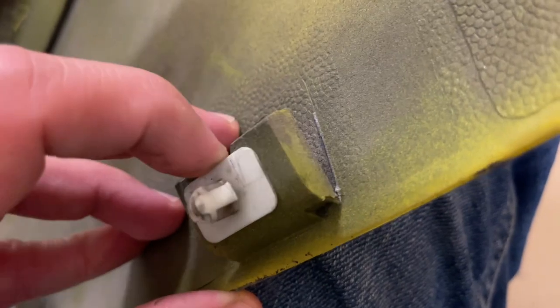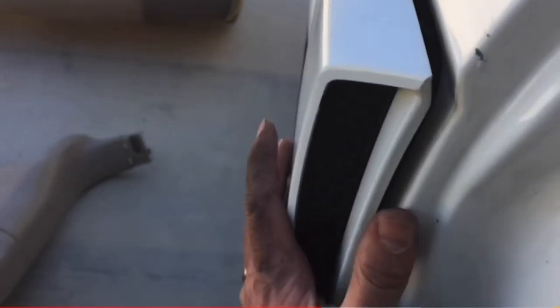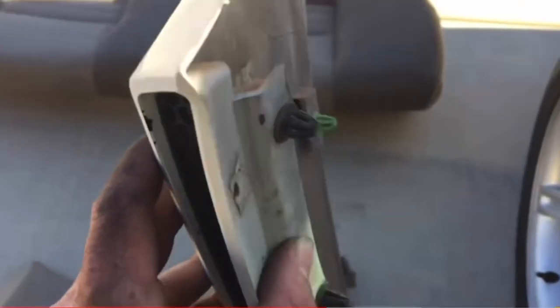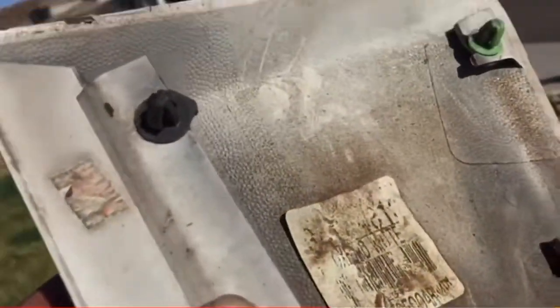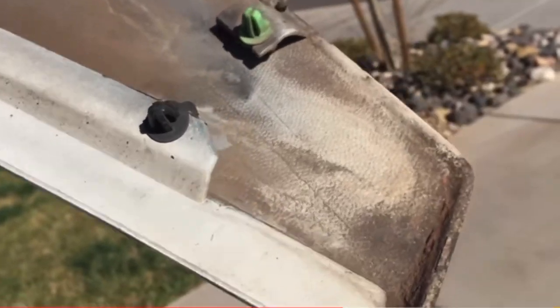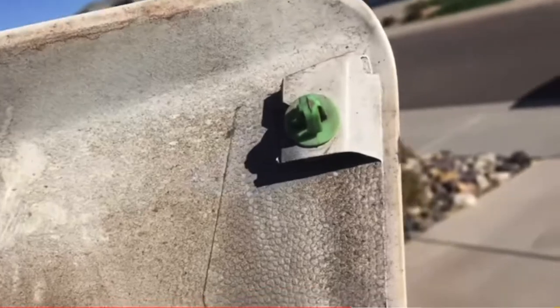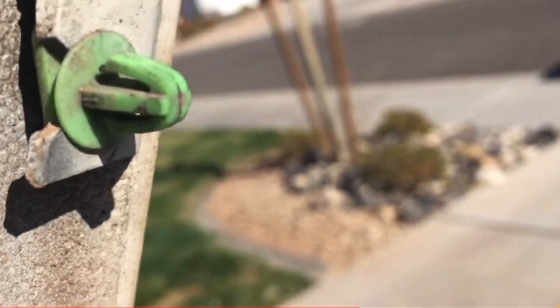What you want to do is come on the inside of the car and push the tabs through the back. It's a little more work to do it this way — you have to undo the interior, which I'll show you step by step in the video. But as you can see, this way you can collapse the little clips and then push them through. I did not break any of the tabs here; they're all still intact. That's the proper way to do it, especially if you're doing this on a car that you really care about.